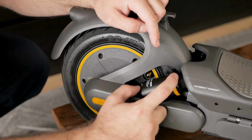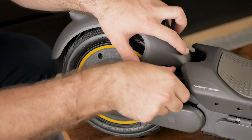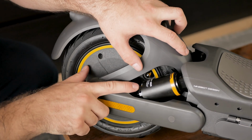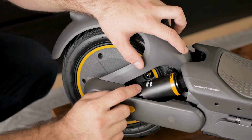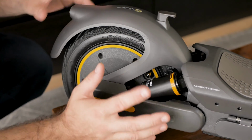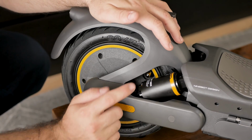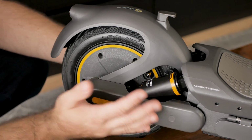2 of these gas things, struts, I guess you would call them, on both sides. And the cool thing is you can actually adjust this. There is a soft and a hard setting here, so you can move it around. There's a screw bit here that you can use the tool to move around. Now, I'm not going to adjust this, but I will test out what the soft and hard really means. But I expect, you know, hard suspension, softer on the left-hand side if you're finding it too hard, if you're going through a lot of bumps.